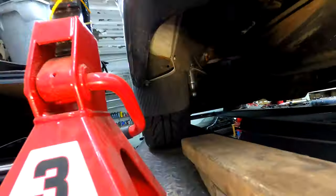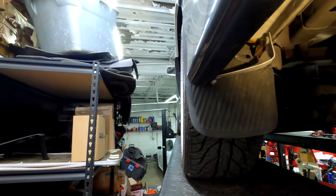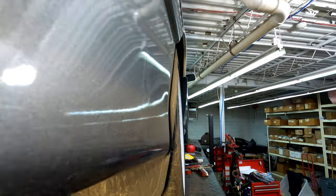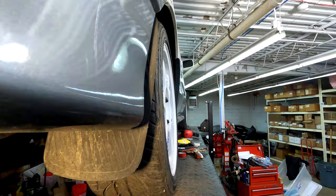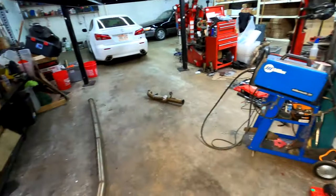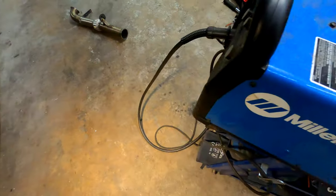I can already see just visually — you're supposed to be able to look at the back and line it with the front tire/wheel to get an idea of toe in or toe out. The camber looks a little excessive but it should be right around 1.5 to 2 degrees — we'll see what it comes out to be. The car will be running and driving within the next few days. I'm going to swap out the steel wire and get some stainless wire in there — Amazon yes-welder stainless steel solid core — finish up, get the two V-bands on and we're done.